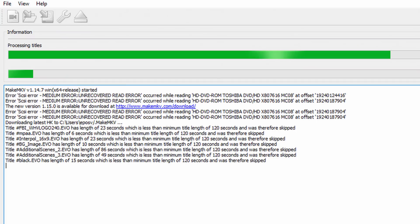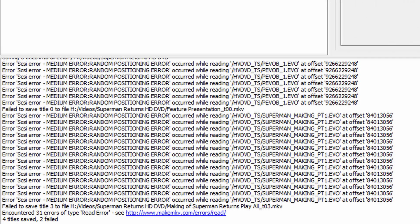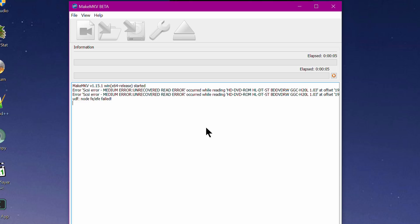As I was doing my personal ripping to make this tutorial, I started running into some discs that gave me errors — weird messages where it couldn't even open the disc, such as 'random positioning error occurred' or 'medium error unrecovered read error,' as well as some USB timeout issues. The USB timeout issue is a not-uncommon problem with using USB optical drives for ripping, especially with MakeMKV, where trying to load a certain section of the video takes so long that the USB connection times out and it loses signal and can't finish the rip — which is why I typically recommend internal drives. Especially since this is a USB 2.0 drive, that's a lot of data to send over USB 2.0.